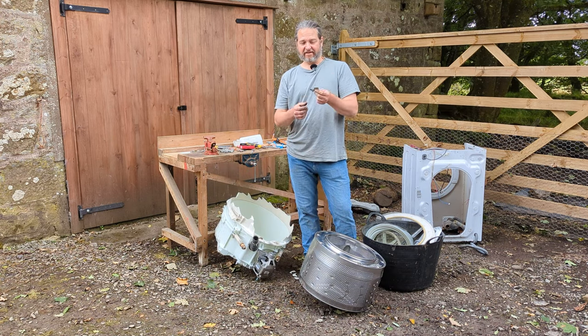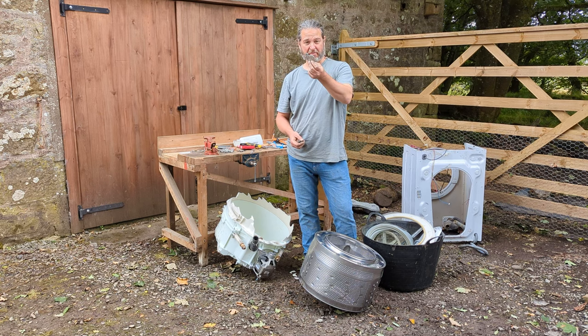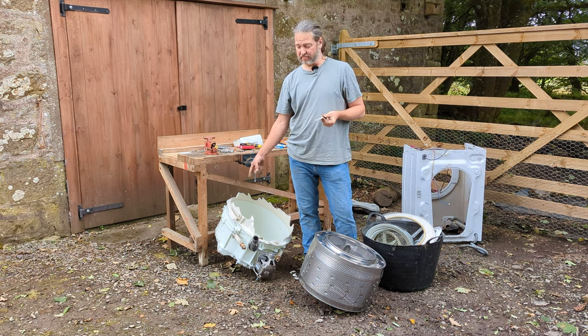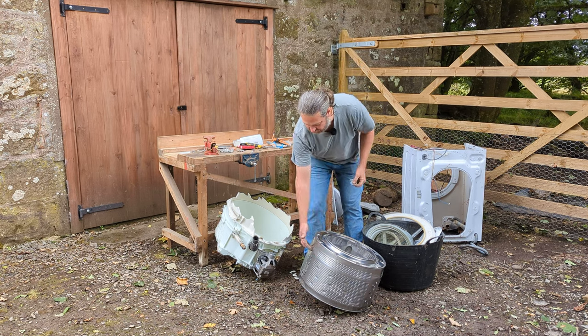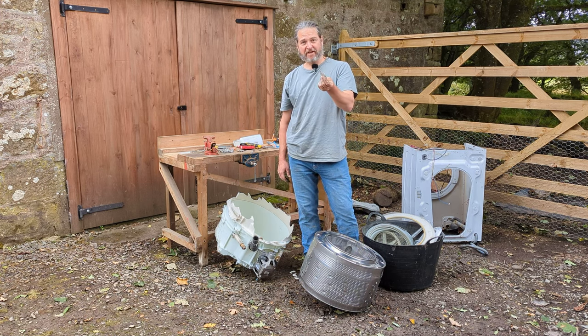Well, I found the projectile — it is a keychain. My keychain that my wife bought for me as a Christmas present a few years ago. It became a projectile inside the drum during the spin cycle, knocked a hole in the drum, caused the leak which caused the rust, and eventually it wiggled into such a position that it was catching on the outside of the drum and destroyed the machine. Check your pockets.